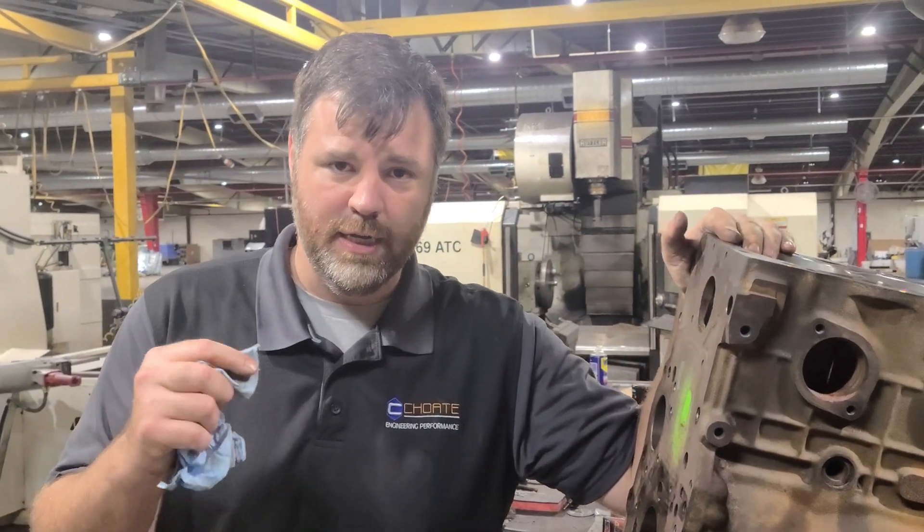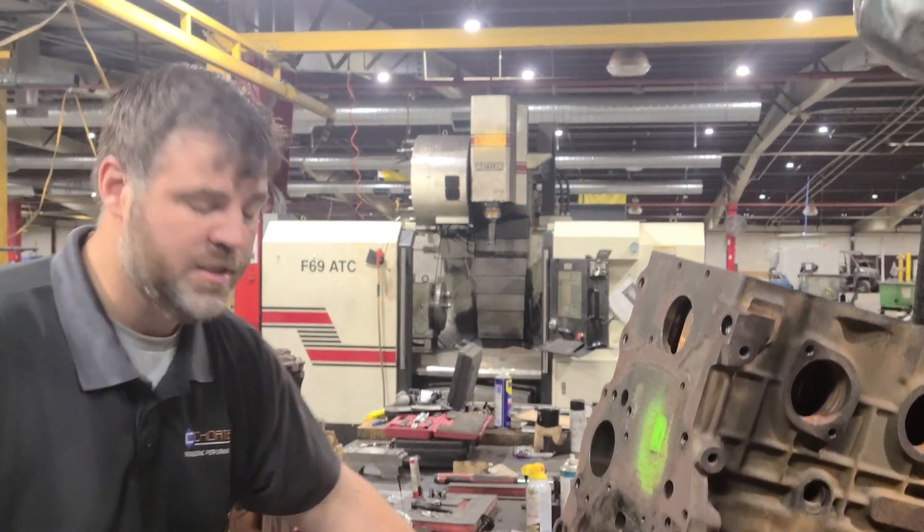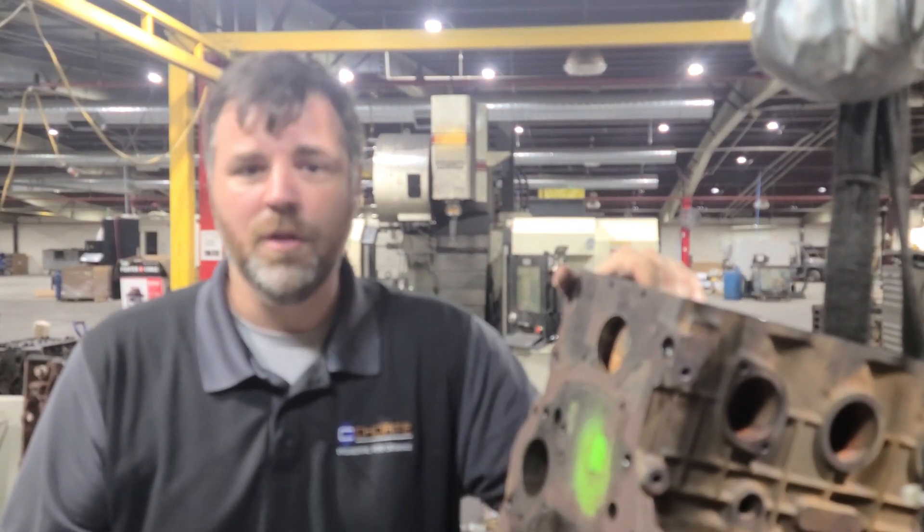Quit doing this. If you're going to install a new engine and you've been one of those people who put this junk in your engine, don't run the same radiator. Don't run the same oil cooler — please, for heaven's sakes, don't run the same oil cooler. Don't run the same heater core, hoses, and all the components that go with it. Because all you're doing is overheating the new engine — it can't cool properly, and you're going to call your engine builder wondering what went wrong. I'm trying to save you money. I'm not trying to be mean, but I'm certainly trying to be helpful. So don't do that anymore. Get rid of the devil in your engine. Thanks, guys, for watching.